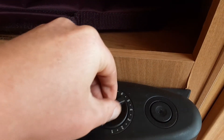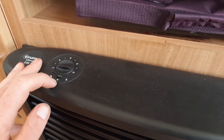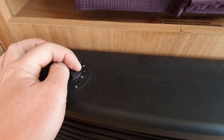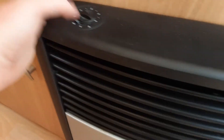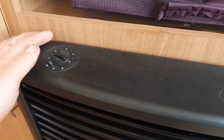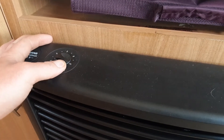You can then control the temperature of the heater on gas on the dial on top. On the opposite side of the heater on top you have your blown air options. Around the caravan you'll see little white vents — that is essentially blown air heating like you have in your car. The switch with the dot indicates heat just coming out the front of the heater. If you select the wave symbol on the left-hand side and turn the fan speed up, you'll hear the blown air heating kick in. We do advise leaving the heater to warm up on the central dot setting for 5 to 10 minutes before turning the blown air on, otherwise it will just keep cooling the elements. If you want automatic blown air that cuts in and out with the thermostat, set it to the A on the right-hand side and the fan will cut in and out as needed.